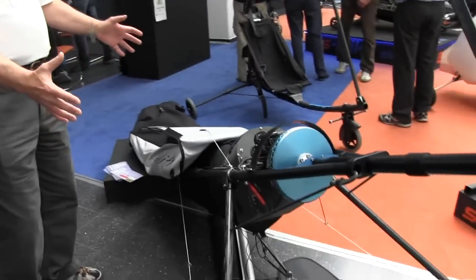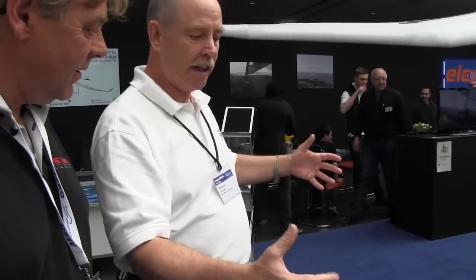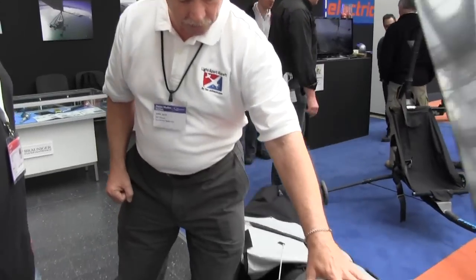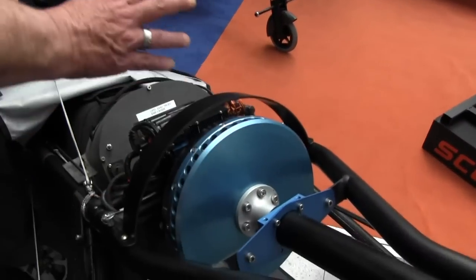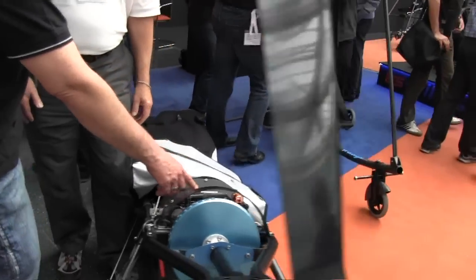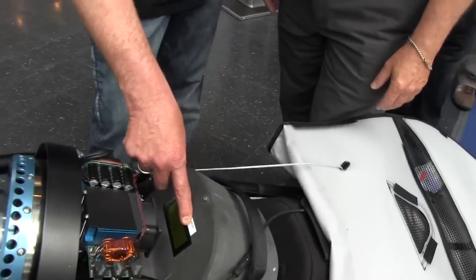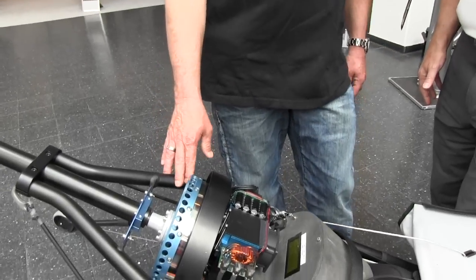First of all, Edward, I look at this arrangement, which I know to be a harness that a hang glider pilot wears and then gets into his hang glider and flies away, and he's doing this with an electric motor that looks very sleek and small. One question I have is: where are the batteries, and how do you carry all the batteries in this package? So it's very easy to see. Here is the engine, and here is the battery package. We're working with a 24 ampere hour, 58 volt battery, so we have enough power to have a good climbing rate.